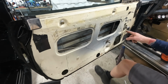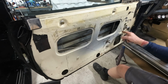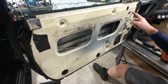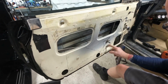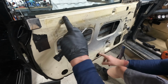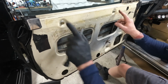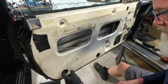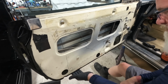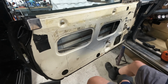So the key is this cable from the bottom of the roller goes up to here. The top of the roller goes down. So put the down one on first around this one. Go all the way across, over, down, up, and then you're good. And then this is your tensioner. I had to loosen these two to get it on there. These two are fixed. They're on a rail down here. There's screws down here, but they're tight, I think.